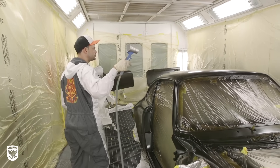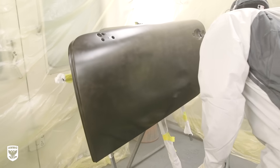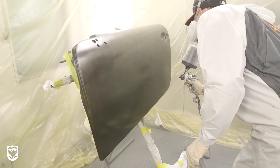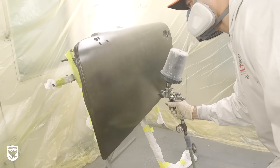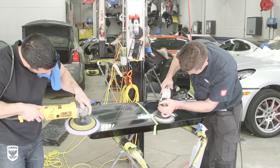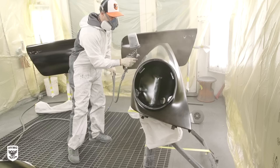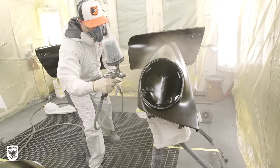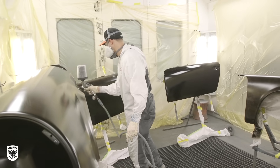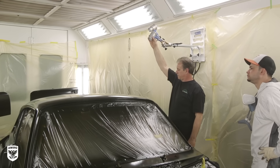After about 15 minutes the base coat number one is dry and base coat number two is ready to be applied. This layer is thicker than the previous step — notice his slower arm movements, which lay down more paint. It's the same idea when detailing a car with a polisher: the slower your arm speed, the more aggressive you are to the paint. With slower back-and-forth movements, the spray gun releases more paint for a given area, building up thickness at a faster rate.